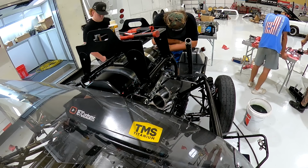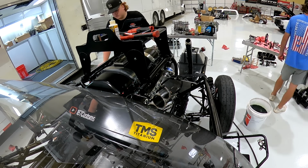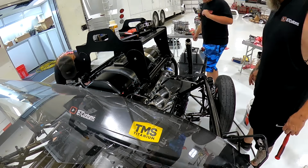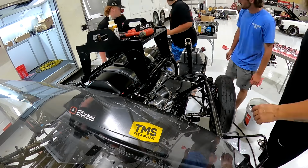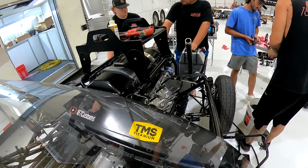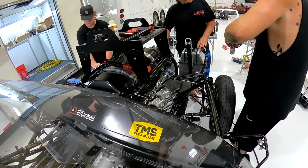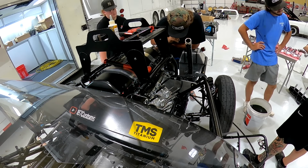The reason for tearing it apart at 30 passes, or actually we're probably going to run 35 now that we know everything looks good at 30, is to change this rack of pistons out while everything is good and nothing's broke. All we're doing is putting new pistons, rods, rings, and bearings in this deal. The rack of pistons, rods, and piston rings is about $3,500.